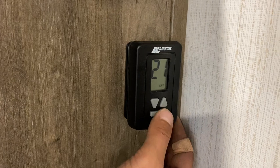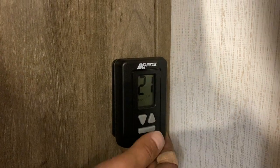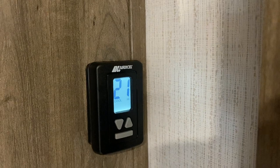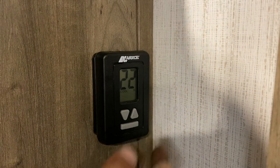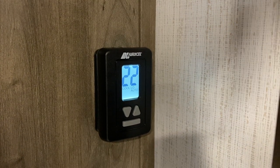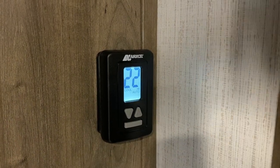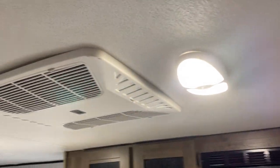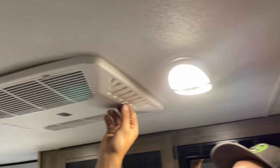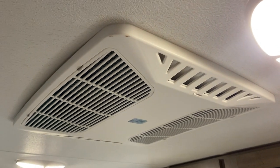The thermostat is in the top corner. Press the bottom bar to wake it up and it'll come into fan low, which just moves air with no cooling. Fan high does the same — just moving air, no cooling. After fan high it comes into cool high, where the compressor cuts in and out as needed with the high fan running all the time. Cool low is the same idea with the low fan. After that is cool low auto, an on-demand system where both the compressor and fan cut in and out as needed using only the low fan. Then cool high auto — on-demand using the high fan. With the air conditioner running you have two louvers: both closed uses all the ceiling ducting to move air throughout; open louvers dump all the air directly into the living room. When you first arrive at a campsite, open them to cool this area quickly, then close them to move air throughout.